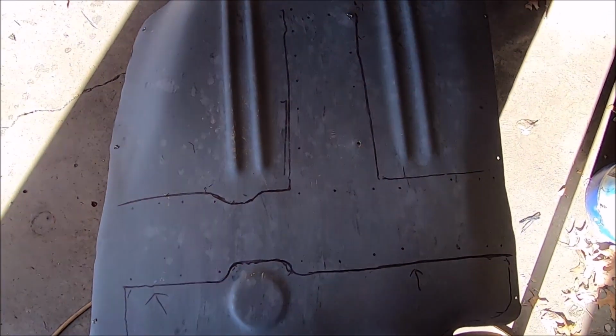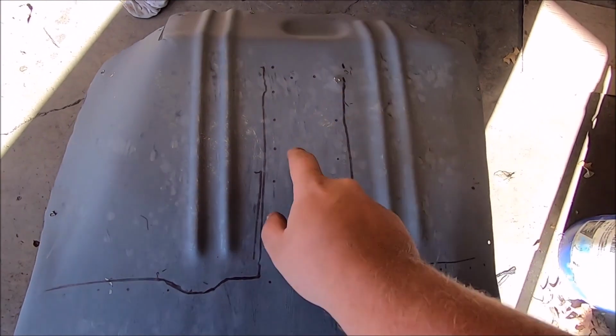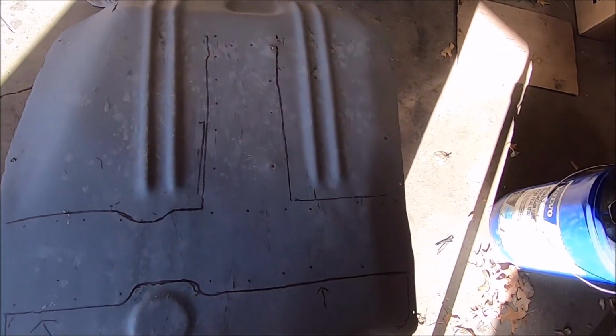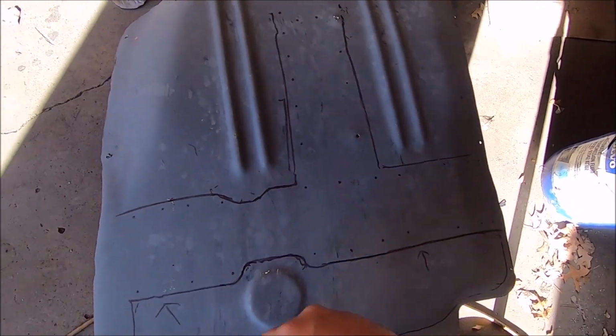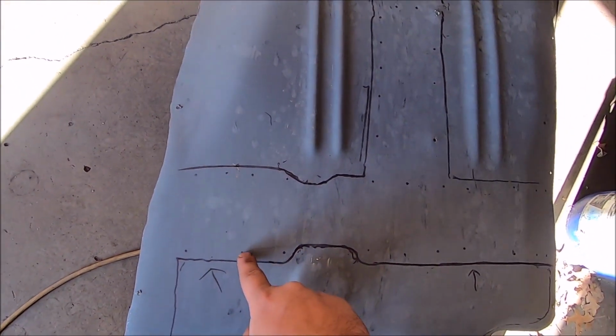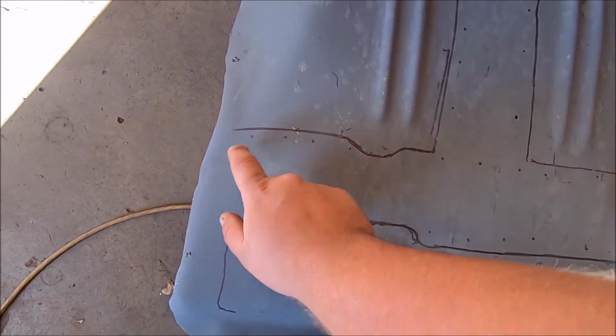we got this kind of well marked out. You know, we got it tech screwed to the frame rail, the front frame stub, and then all around the perimeter as I showed you last night. And did our best to try and mark this out. I came in 3 3/8 center for bolt to bolt, where I'm going to put my spot welds. I'm going to put plenty.